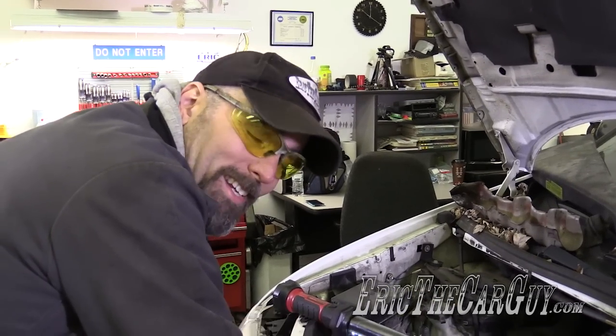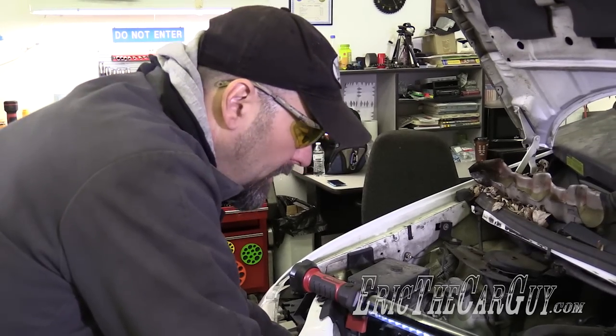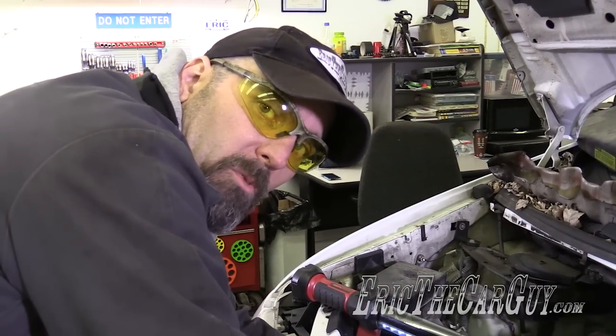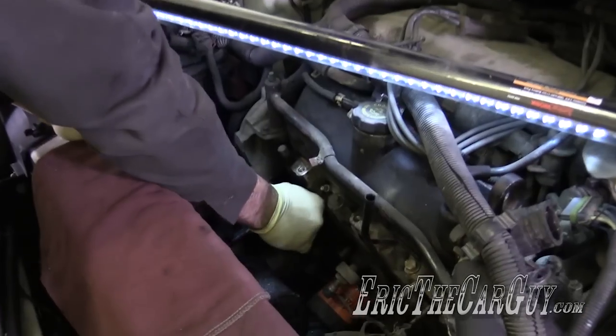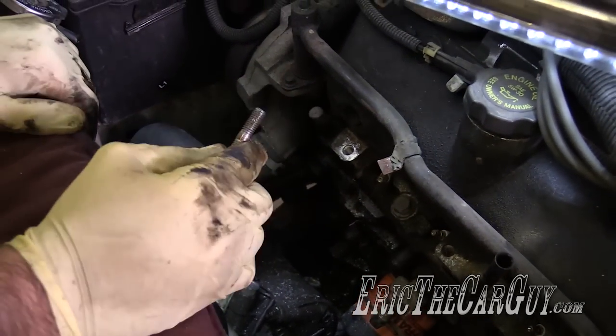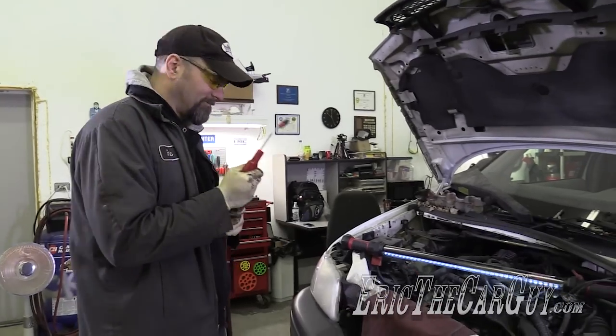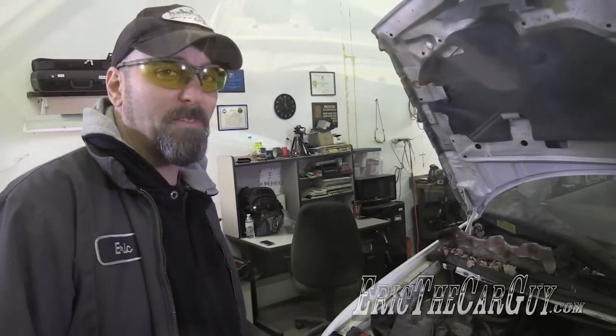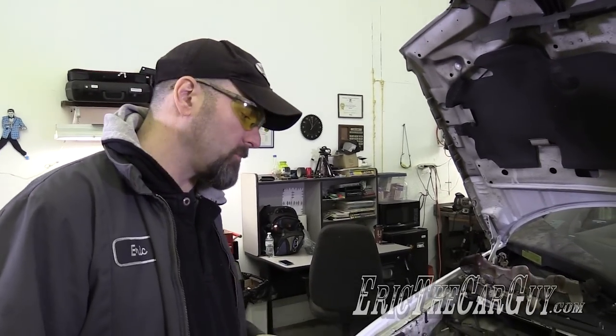A couple of things I'm concerned about: first, I'm going to have to make sure there's no coolant inside this hole, or as little coolant as possible when I put the JB Weld in, because we want the JB Weld to adhere to the metal. So I'm going to go in with a little bit of compressed air after I remove the stud and try to get as much of that junk and coolant out of the hole as I can, so that when I reinsert the stud it goes in clean. As we've used on several occasions during this repair, I'm going to bust out my torch. If I keep hitting that with compressed air, I'm just going to blow coolant everywhere — I'm looking to dry it out. Evaporation is a good way, so I'm just going to kiss it with a little bit of fire — just enough to get the metal around the outside warm enough to evaporate whatever's inside that hole.